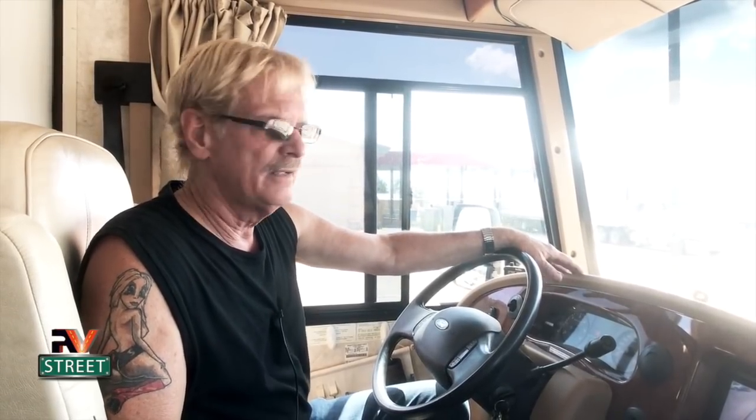I'm back in the coach giving it a few seconds — she's up there busy with customers and also watching the scale. Last time she gave me a prompt on the intercom saying she got me. Now, this is how you do a four-corner weigh on a cat scale. It's not as accurate as Escapees, where they put an actual scale under each tire position, but this is going to get you pretty close. Remember, every time you weigh, make sure all people, pets, cargo, propane, water, and fuel are on board — everything. That weight tells you how much pressure to put in your tires.